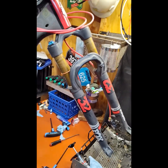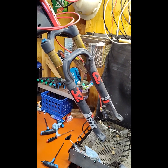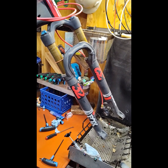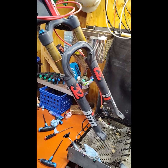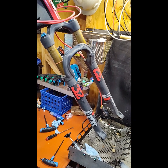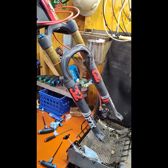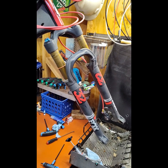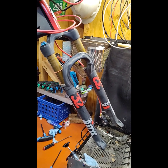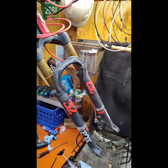I'm doing a travel change from 100mm to 80mm, shortening it up to steepen the actual head tube angle of this bike. By 'actual' I mean unweighted height — no sag on the fork, no weight on the fork — it sits at 80mm, and that's the actual head tube angle. Effective head tube angle means when you sit on the bike, you subtract the sag out, and that's your effective angle.